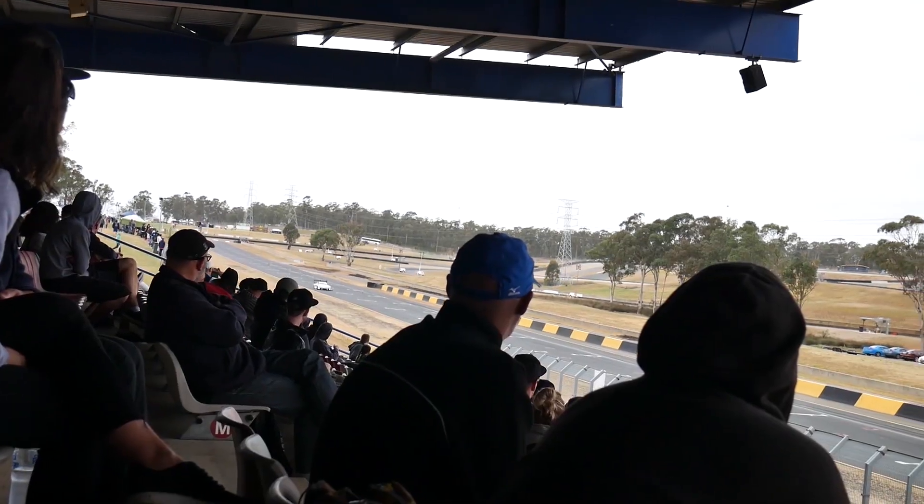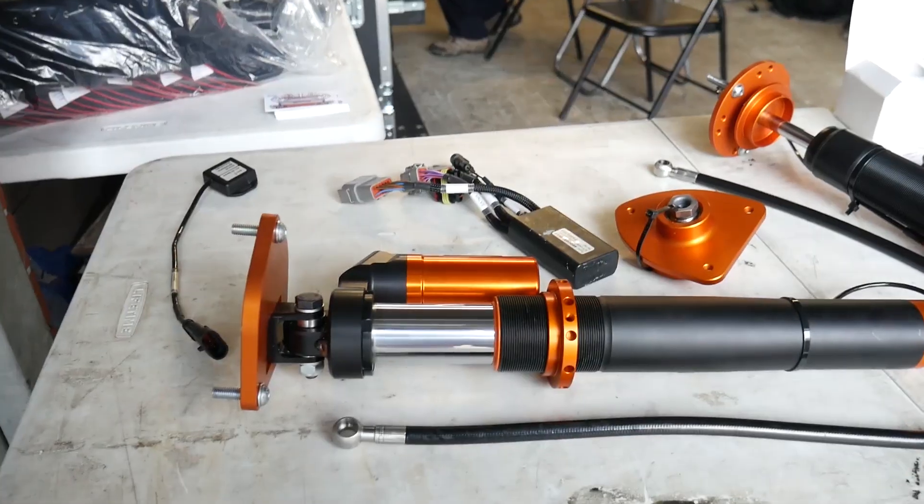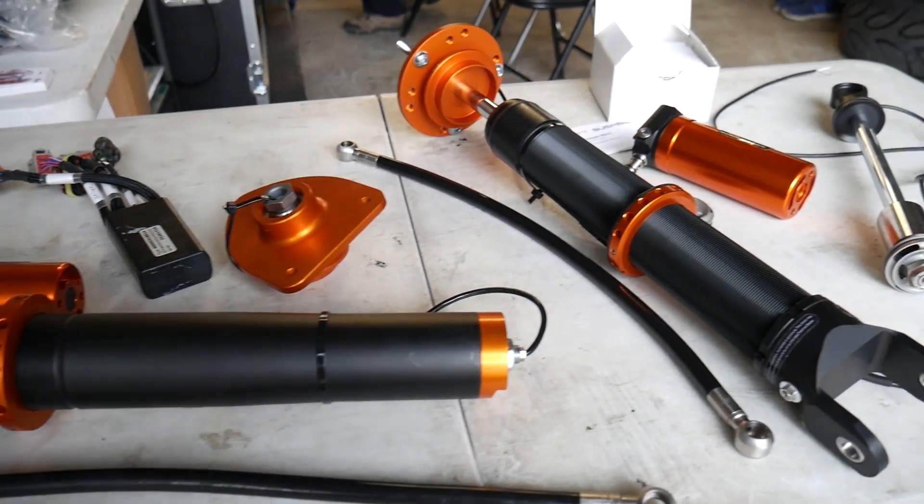Is there scope to implement some sort of active ride height control to compensate for aerodynamic loads and keep the ride height level? Tractive Suspension also offers what they call an EPA — Electronic Preload Adjuster. It's a hydraulic cylinder that sits under the spring and can travel about 15 millimetres in 15 seconds with a 10 kilonewton load, so it can be used to control ride height in a time attack car. They're often used on enduro cross bikes and on road cars that need to go over speed humps.